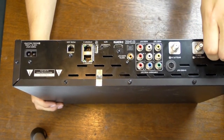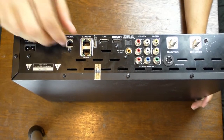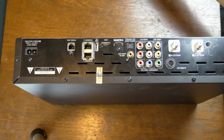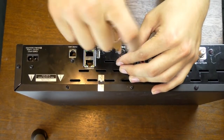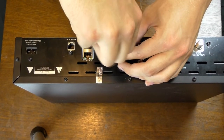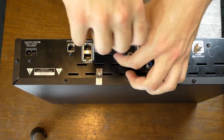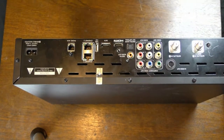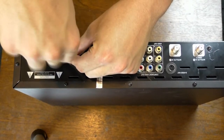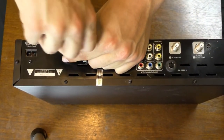This had some special tamper-resistant screws. You can see I haven't actually opened it yet — this is the void-if-opened warranty seal. All I did was I broke the screws using a pair of pliers, just enough so that way I could finish unscrewing them with this screwdriver. But they have a special tamper-resistant star bit on here to basically stop people from being able to take this apart. They have a little nub in there that's supposed to stop star drivers from going in deep enough to actually start unscrewing. So you have to have a special star driver with a divot in the center of the tip to actually go all the way down in there and break the screws. But like I said, I broke them first with a pair of pliers, which gave me enough leeway.